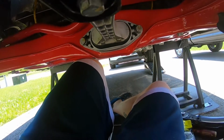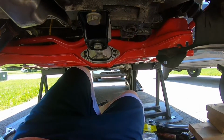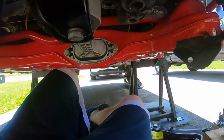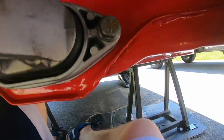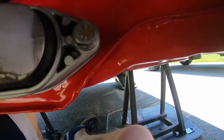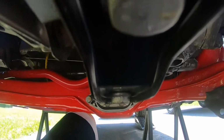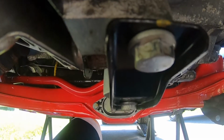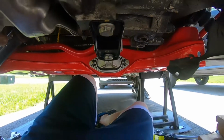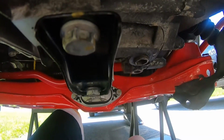So for some of the torque specs as we're going along here, I'm going to try to write everything down in the description if I remember. But pretty much these two little guys, the 13 mil for the dog bone, we're looking at 15 foot-pounds, so not too much. And then I believe these two right here are 30 foot-pounds for both of them. I'm not sure, I have to take a look as well, but there might be one of those rules where you do 30 foot-pounds and then a 90 degree turn just to make sure.